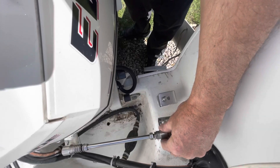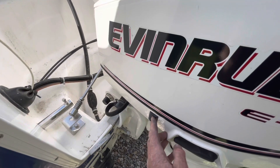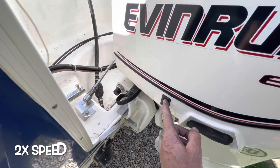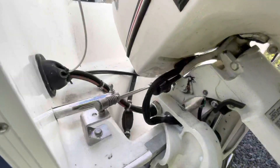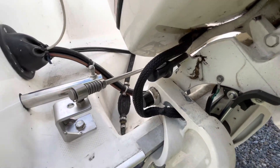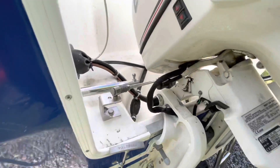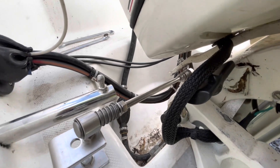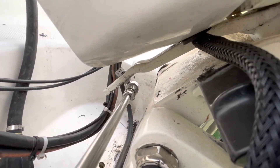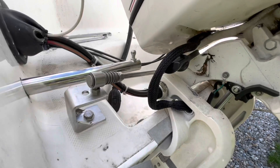When you're ready to lift or tilt the motor, just hook it here. Let's see how that works. I thought I was done, but when disconnected, turning right is fine — turning left catches on something. I realized I should have put the nipple on the engine facing down, so I tried that. With the nipple facing down, now I have all the direction I need. It doesn't catch anything either way. Good — no more resistance.